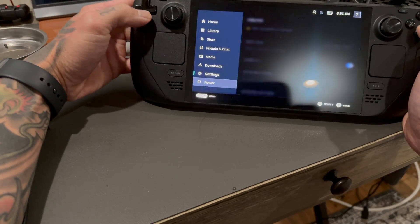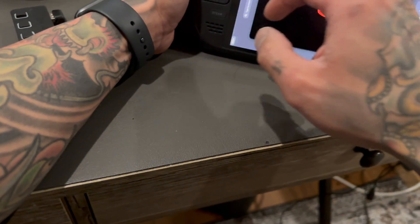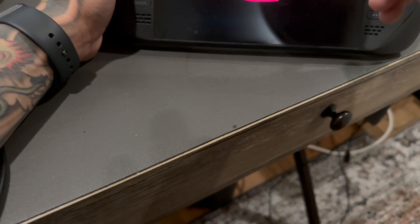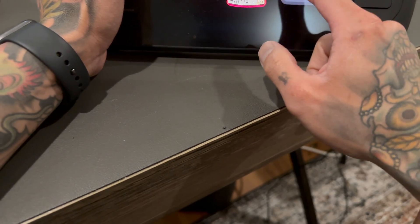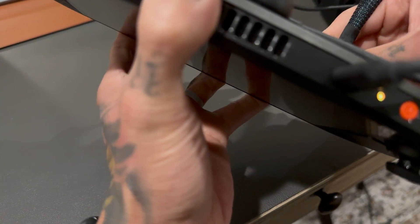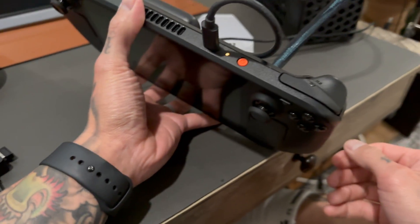Let's get on Wi-Fi real quick — Wi-Fi is not working out of the gate like it was before. We can still do LAN. Let's go to desktop mode. The OLED screen looks so good. We have one fan spinning on the graphics card, which I don't think is a good sign — there should be no fan spinning. We're going to power down and might need to go into the BIOS to unlock the M.2 port.